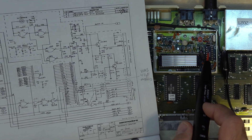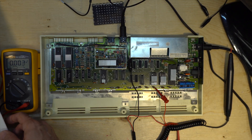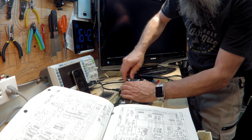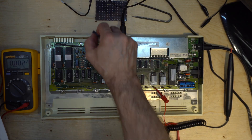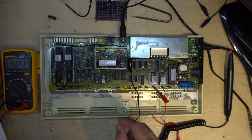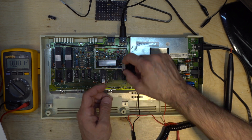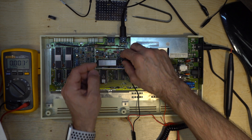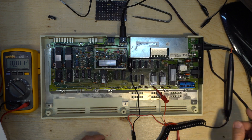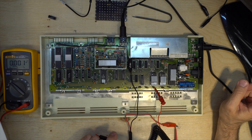So first thing, we'll try to change this chip. Let's turn off the computer and take out the chip. It's an 8302 — if it's a Mitsubishi, it's equivalent to a Texas Instruments 7402. Pin one up there. Let's try to put this back here — every pin is inside. Let's power up again. Oh, and we have a screen! We have a working computer.